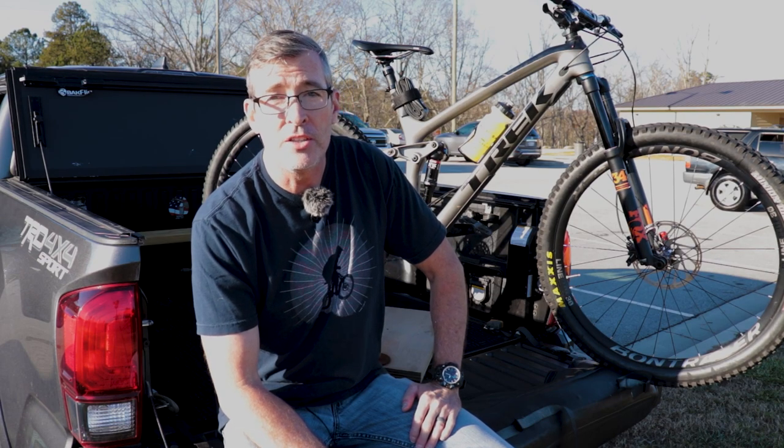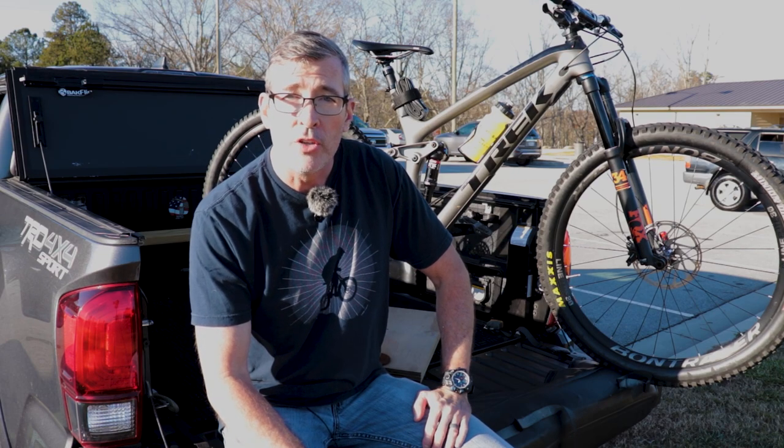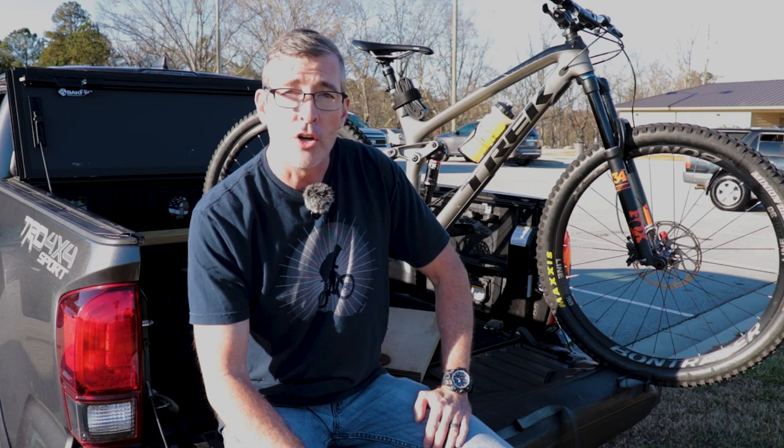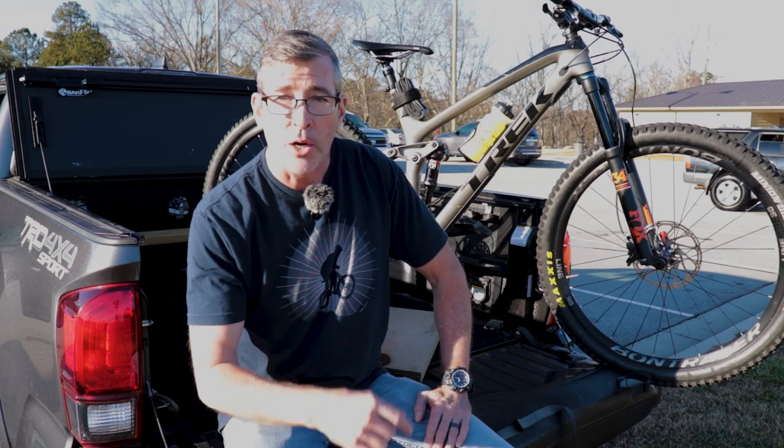If you've never ever checked it, or you're afraid to make any changes, it's okay — you're among friends. Let's fix it. The first thing you want to do is check the condition of your shock. If it's a brand new bike it should be fine, but if you bought it used, it's a good idea to take it apart and look at all the seals and O-rings and make sure that they're greased. I did a video on this and I'll link it right here.